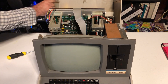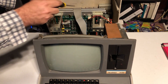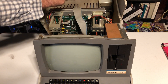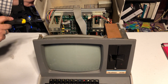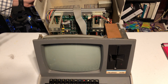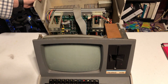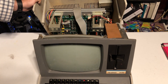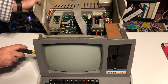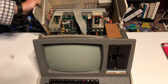So, what do we have here? Of course, this is the floppy drive; the logic board is behind the screen. The power supply is actually there, which is why it has the fan right above it. This one actually had a memory expansion, which is why it has 64 kilobytes of memory. The cards on the other side — at least one of them — is the controller for the floppy. You can actually change the controller to get a different floppy disk than what the machine originally came with. It's very clean and very neat inside. The analog board, which you can't see, is at the bottom of the case underneath the CRT and contains all the CRT controlling circuits.